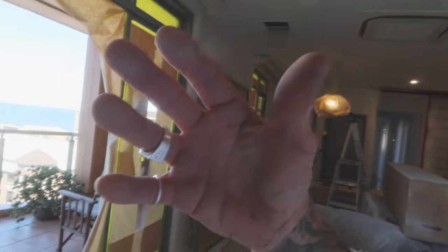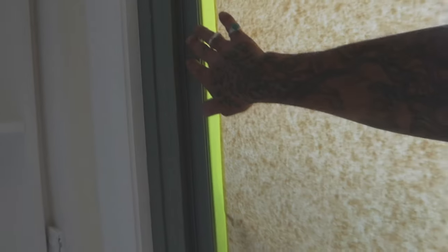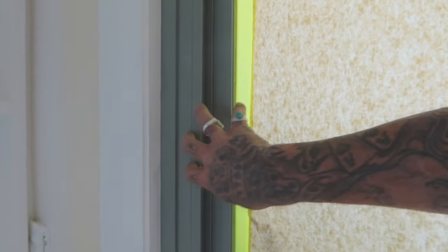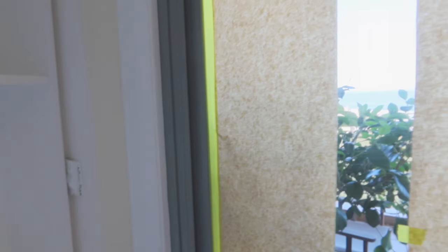So now after we go through everything taped up and completely sanded, give it all a good dust down. Like I say, it's so important that if you're sanding down a surface you dust it down. It's very important. Otherwise, there's no real point sanding if you're not going to dust it, because all you're doing is getting dust onto the surface, then you're applying your paint over it, and you're going to definitely jeopardize the adhesion. So you always want to make sure it's 100%.